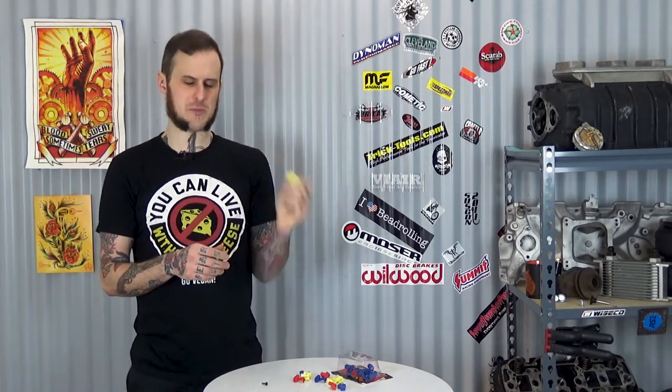So they're just not a good option, any way, shape, or form. They are not what you should do when you need to splice into a circuit. Or I've seen a lot of times trailers are really bad for this. They'll use these instead of butt connectors. That drives me nuts. I've looked at $3,000 brand new trailers I was interested in buying, stuck my head underneath them, and they were covered in these stupid Scotchlok things.